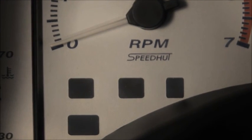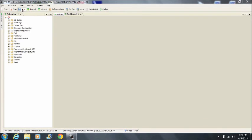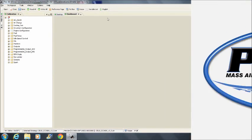Lastly, you will find that your check engine light is on. That's from disconnecting the IAC during the idle setting process. This can be cleared with the scan tool feature in your laptop. Clear the codes and start it up again. If the check engine light stays off, then you're done. If it comes back on, then read the codes to see where the trouble lies.